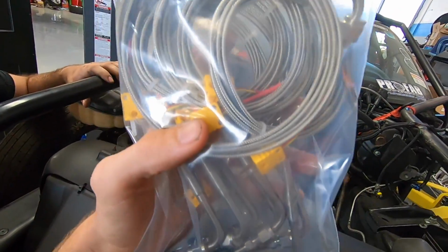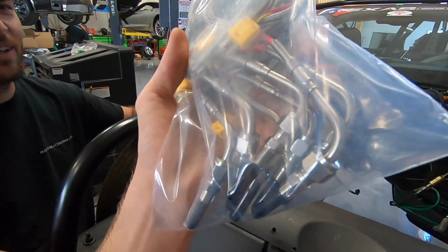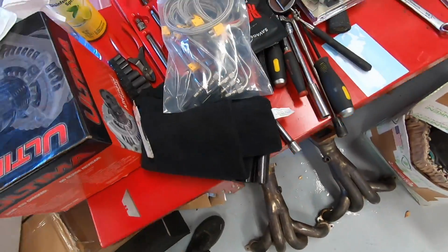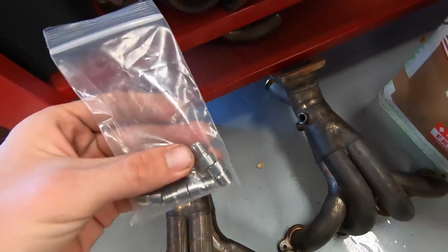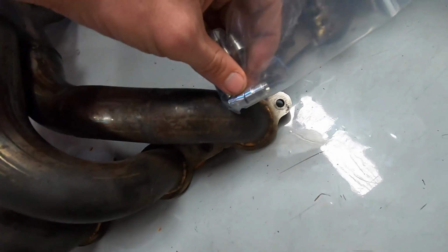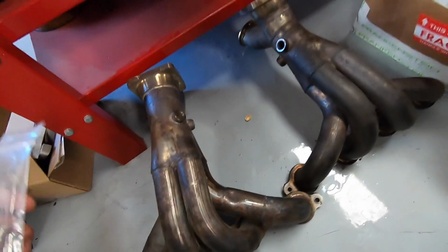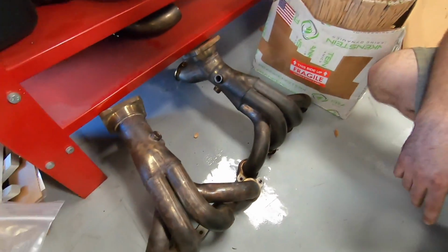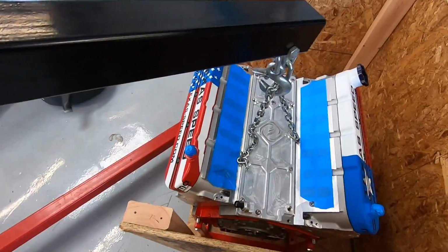These are gonna be pretty sick, and the kit is all plug and play, so we don't have to do much work, which we're excited about. Before we get the manifolds coated, we have to go to ProFab, because I heard McFarland Fabrications is too busy until the end of the year. They're gonna weld little bungs onto each one, and then all we do is put the probes in, and we have our EGTs. We plug it right into the Holley, done deal. That'll be in our data log now. All right, give her a scooping, James. Come on now.